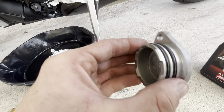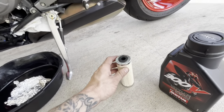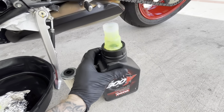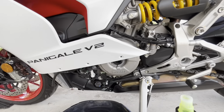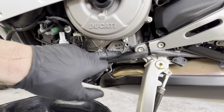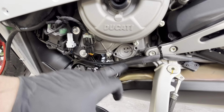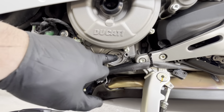Don't forget to lube the seals a little bit — get a little oil on them. Then fill the housing a bit and pop it in. Look at that stuff — lime green oil, isn't that awesome? When you pop the oil filter in, you'll feel a click. This cap isn't symmetrical so I'd always put an arrow or marking indicating which side is up. It'll pop in nicely — don't force it. You'll feel a nice click and you'll know it's in right.